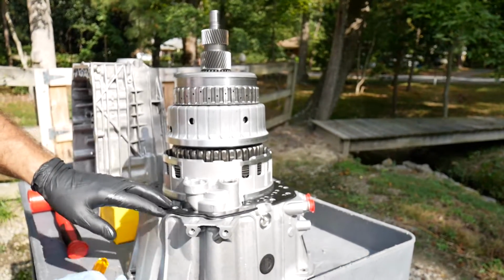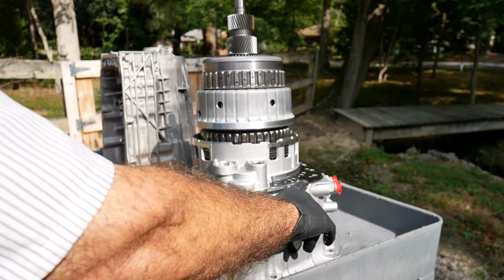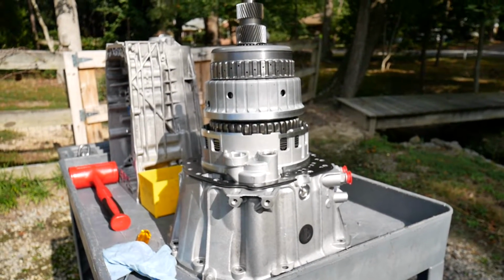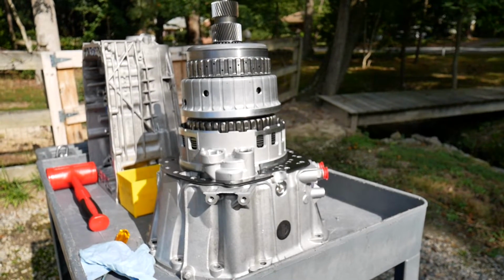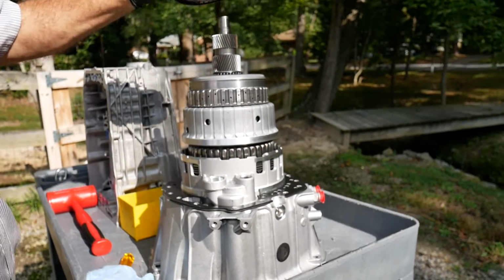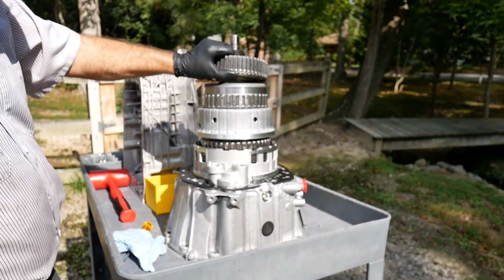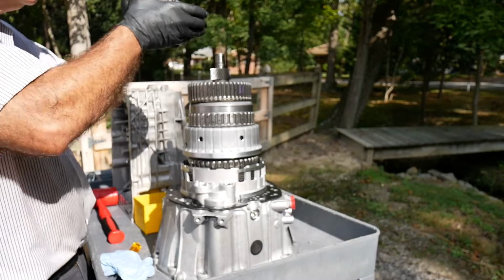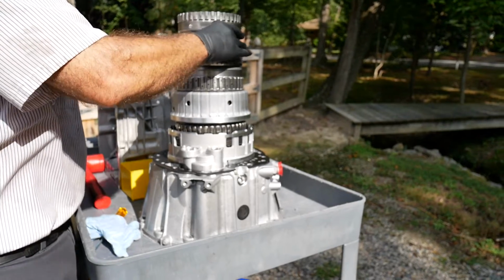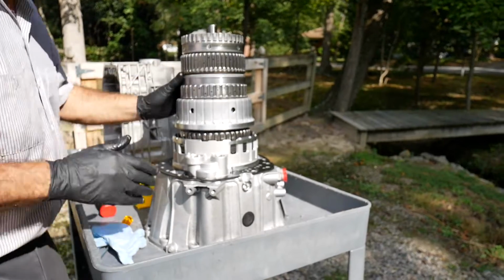As we install the case over the gear train, the case should come down snug against the gasket. If it does not, then what's happened is something is misaligned. Now we're ready to install the P3 internal gear. Note that the Torrington bearings are captured. Don't have to worry about retaining them with lubricant. Takes a moment just to get the components lined up.